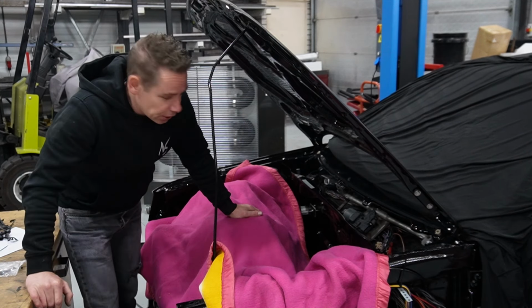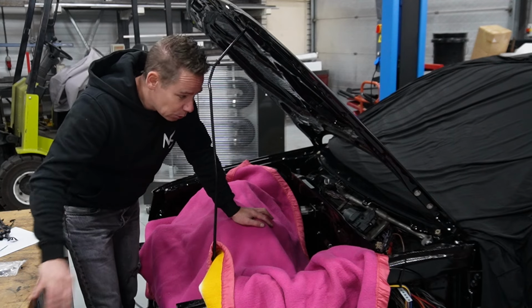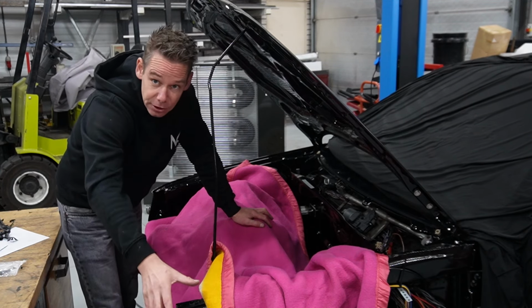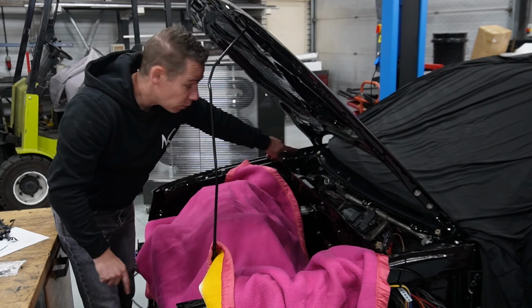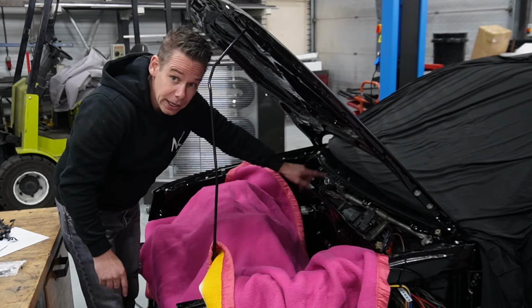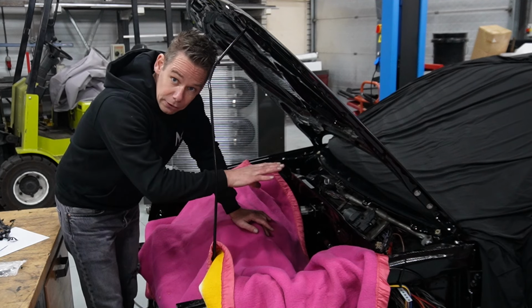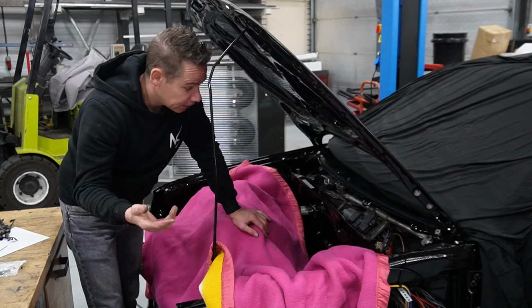Okay, so what am I doing right now? It's a little bit complicated. Two things in one. Of course, we want a clean engine bay, so all the wires need to be hidden and go around the outside. On the other hand, we moved the computer to there, so I'm bringing all the wires to there, and we're going to repin from the Mark IV wiring to the Mark III wiring, and it needs to be lengthened.